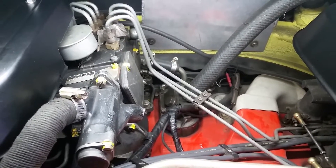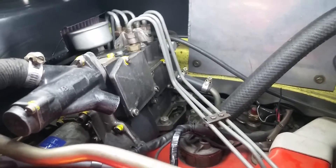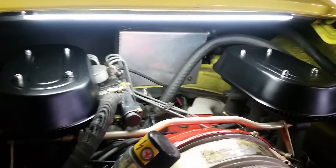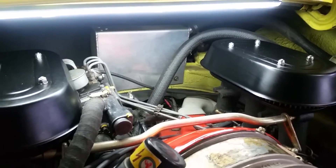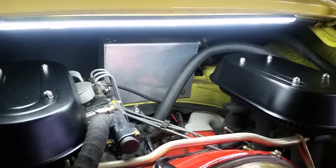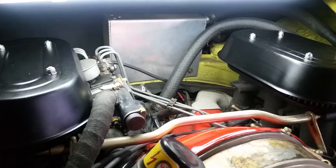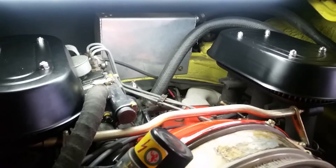The car is infinitely adjustable, and most people don't understand how they are adjustable, but there is the heart of it — the mechanical injection pump. This car actually has K&N rain hat air cleaners on it, as opposed to the normal standard air cleaner. The aluminium box over the back there is just a crankcase breather, which collects any fumes or vapors that come out of the engine rather than going into the air cleaners. So there we go — a bit of an introduction into mechanical injection.